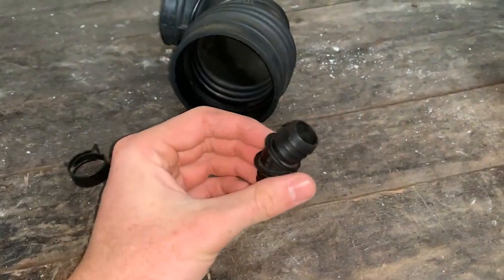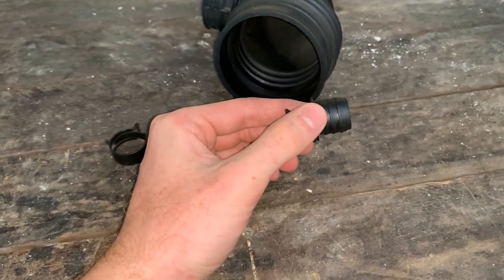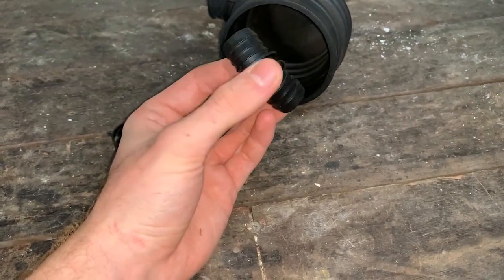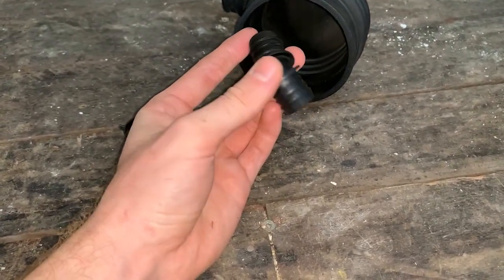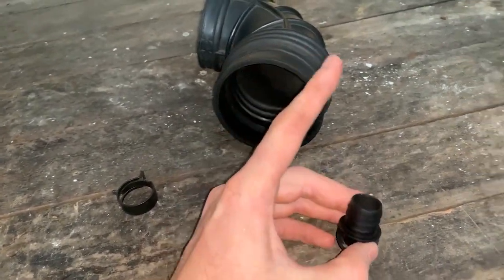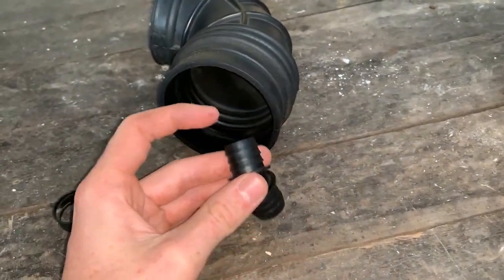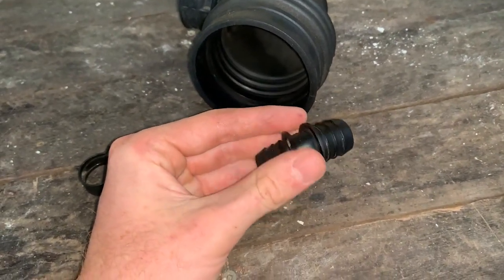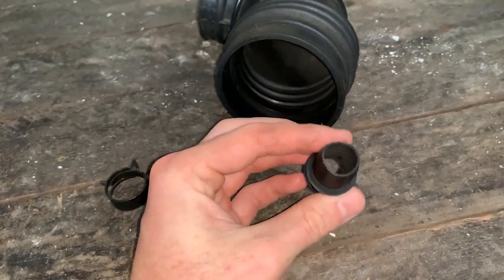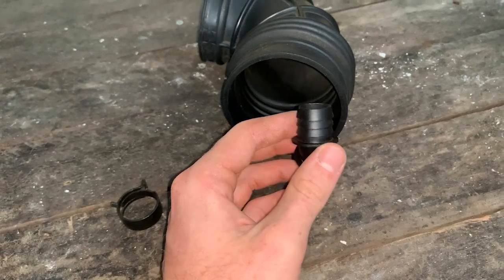The reason why we changed from this fitting to that stainless fitting was because that was actually 18 millimeters in diameter. This is 21, BMW from factory. Not sure why, even though the stock hose reads as 17 and the hose from the ICV reads 17, they are stretched onto a 21. Like, that's really aggressive. So I just got a slightly different fitting to fit all my nice new hoses and stuff.